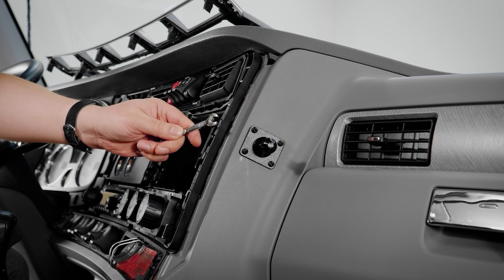To install the cradle onto the pedestal mount, we first want to remove the power harness. This needs to be installed into the vehicle's power system by a professional. To remove the swivel base, you want to loosen the center screw using a Phillips screwdriver, and once you have it all the way loosened, we can remove the backplate by pulling it off.